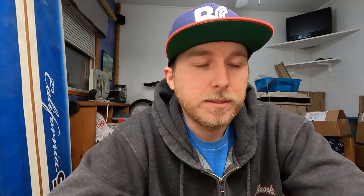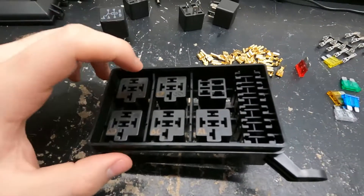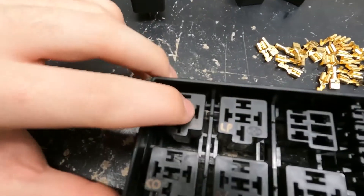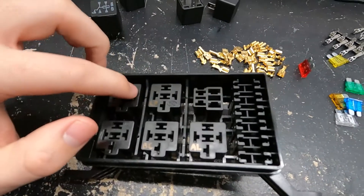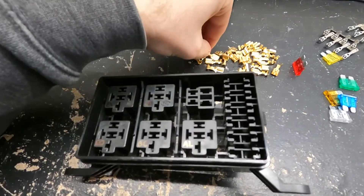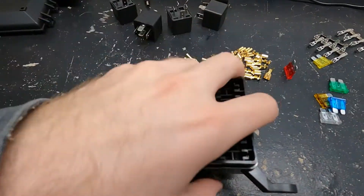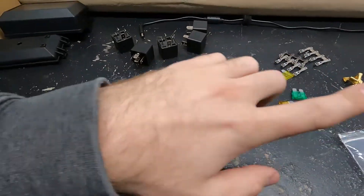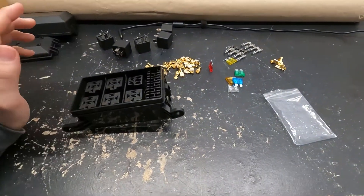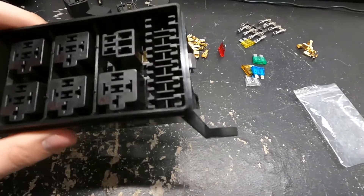For now, I'm just going to wire up the lights, the boost controller, and the anti-lag system. So the first thing I'm going to wire is the ground. The ground's going to pin 86, which is this one on all of these. I'm going to start at the furthest back one, do a loop, put in another one of these terminals, do another loop, put another terminal. I'm just going to do that so it comes out as one wire. I'll probably give it like two feet on there, just so I have plenty of room to find the ground outside of the relay.